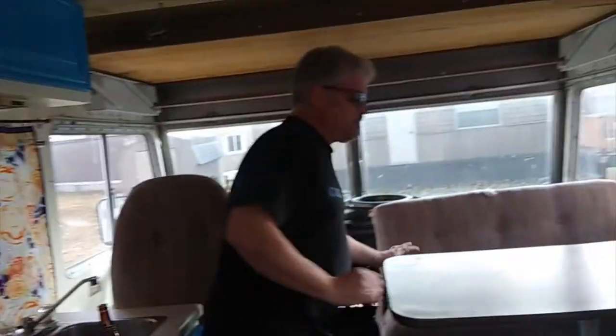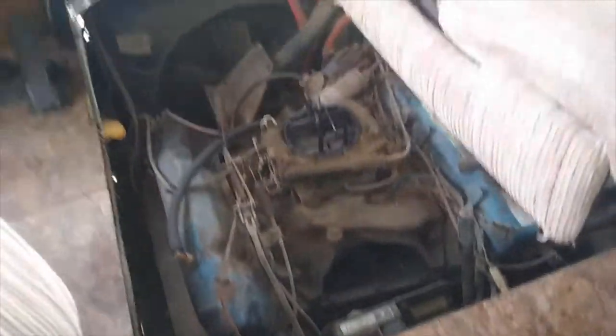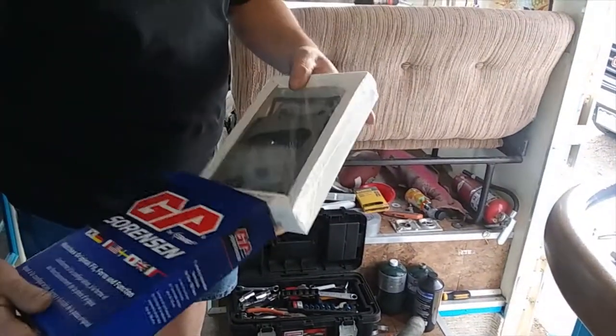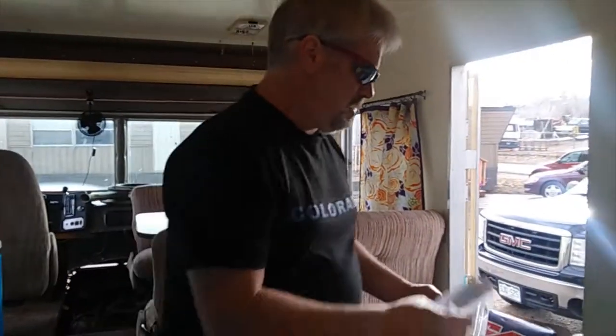We need to remove the seat again — there's no room. We're going to take all the stuff out. But if you look down there, the carburetor is not used to the new fuel which has got alcohol in it, called ethanol. It eats away at the gaskets and everything. We got a new carburetor kit — as soon as you do the seal you can't take it back. But the new parts are alcohol resistant, or so they say. I've rebuilt about 10 carburetors in my life, should go good.